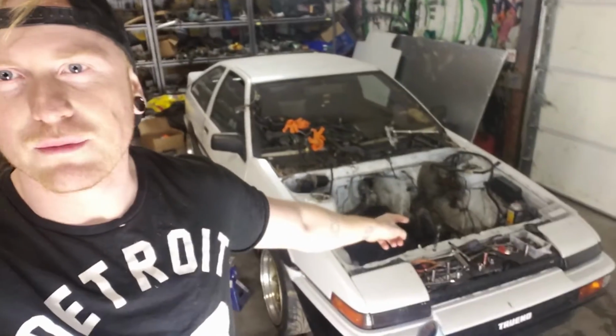All right, everybody. That's a wrap. Got the engine out. Cylinder walls look good. I'm going to flip it around next time. Check the bearings. Make sure that those are good. If those check out, I'm going to have this sent out. I'm going to have the cylinders honed. I'm going to get new bearings, new rings, get the bottom end put back together. But in the meantime, the next video will be stripping down the bay and getting it ready for paint.